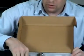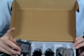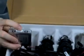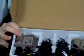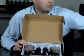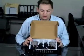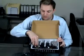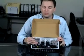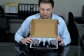The CAN bus kits also have the digital slimline ballasts. They are available in a 9 to 16 volt input. By comparison, the Delonix kits you can plug into a 24 volt system. So a truck or tractor using a 24 volt electrical system can run the Delonix kits that we sell, but any of the CAN bus vehicles only run 9 to 16 volts. So it's the same size ballast, but you'll see on there it is also marked CAN bus compliant.